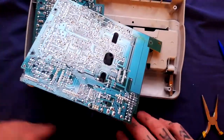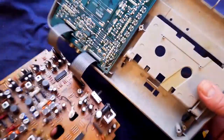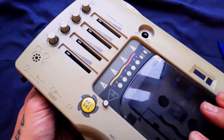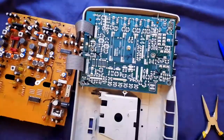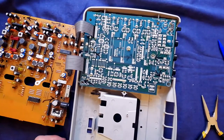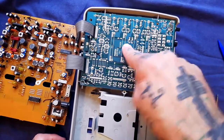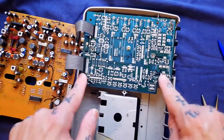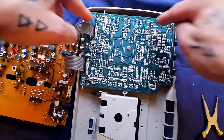It's actually a much more convenient solution than the ring connector thing you see all the time in Tascams. With that out, just tip the board forward from the front slightly and it comes away from the case — so if you needed to desolder and replace any of these components, you've got access to that board. Note that I'm doing all of this on a foam cushion so nothing gets too scratched or battered. The upper input amplifier and mixer board has five screw locations: here, here, here, here, and here.